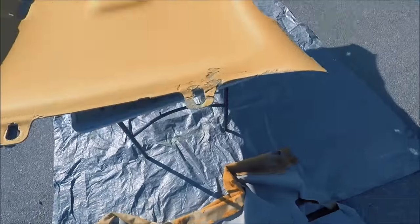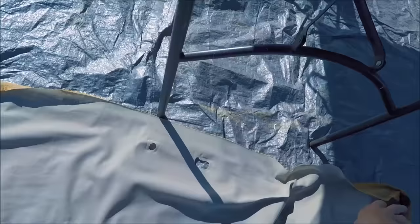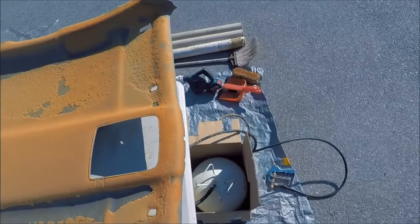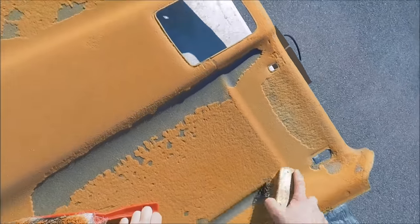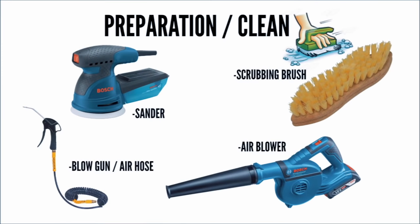It's not a glue issue. The glue is fine on these cars from factory. If the foam just gets old, it starts to crumble and it's usually heat related. So if the car has a history of being out in the sun or comes from a warmer climate, then the headlining board is going to sag much faster. We've done cars where maybe in seven years it's completely sagged from brand new.